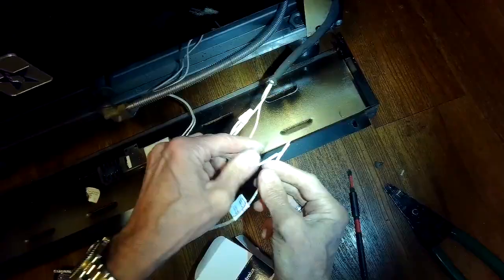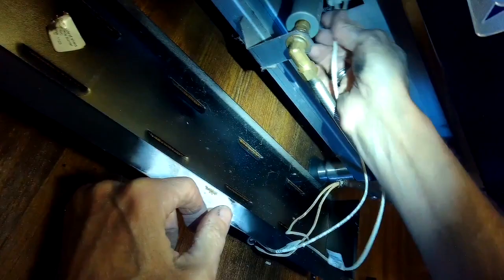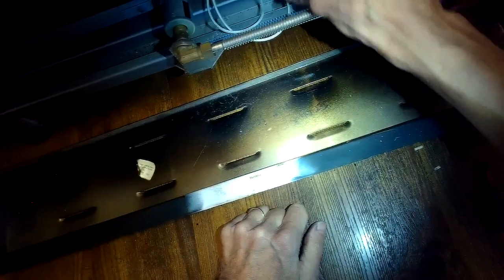I'm splicing in the wires — remember you don't have to worry about which wire goes where; either igniter wire can go to either oven wire. We got it all done and I'm going to push the new igniter into the cavity, get the wires out of the way. You can use a zip tie to hook them further out of the way if you'd like. Then put the cover back on — the bottom part slides in on the two bottom screws and then you add the two upper screws to hold it in. You can literally do this whole procedure in under 10 minutes.